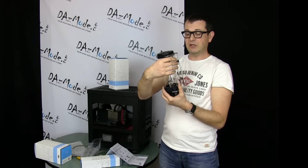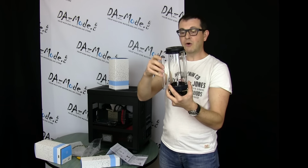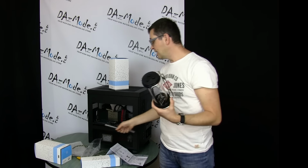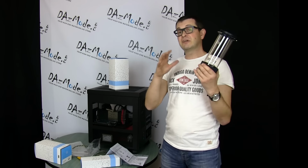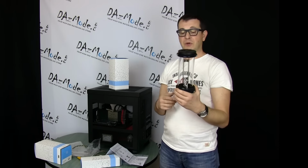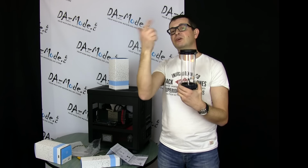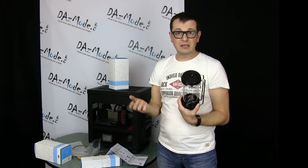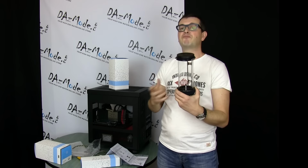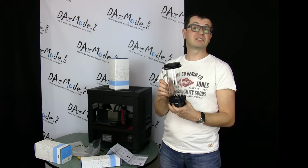So what do we have? Well, basically we have separation of the flow. So we can get in one direction, get out the other direction, and so it will help with separation of the bubbles because you have inlet and outlet in different sections, parts of the reservoir, and also it will break your vortex problem because usually when you have nothing in a cylindrical reservoir, sometimes the setup is such that liquid spins too much. It's not a big deal when your system is bled completely, but it's a big deal in the beginning because all those bubbles don't have enough power to bubble up, and by this vortex they keep recycling through the system, which makes the bleeding process very annoying.